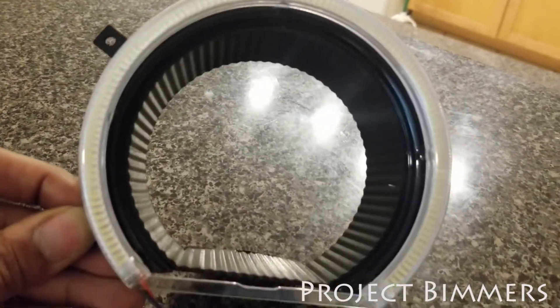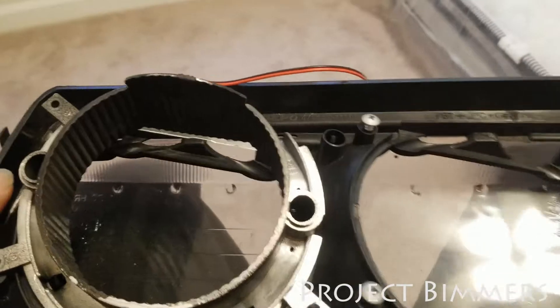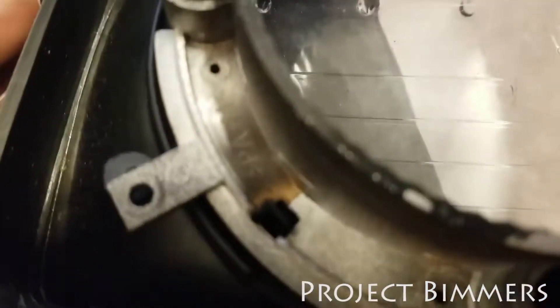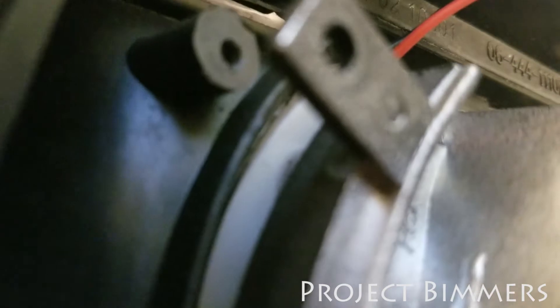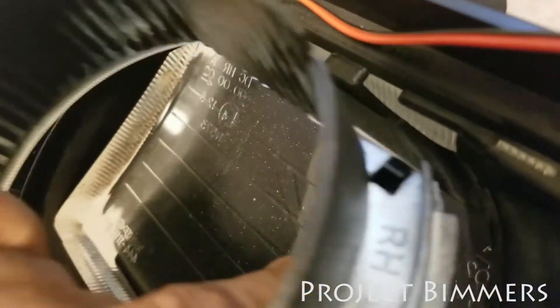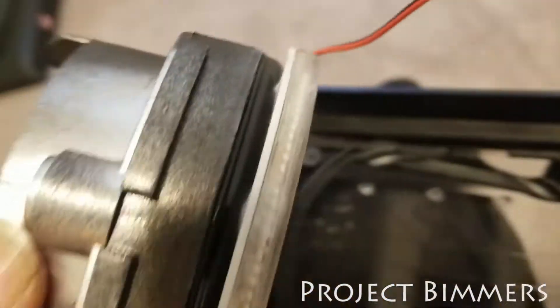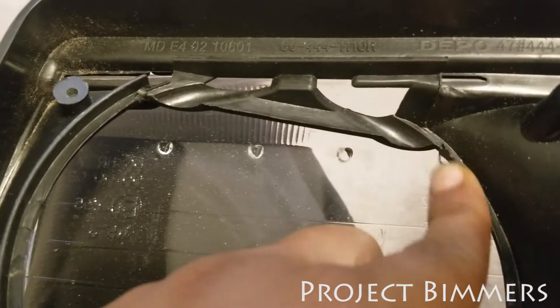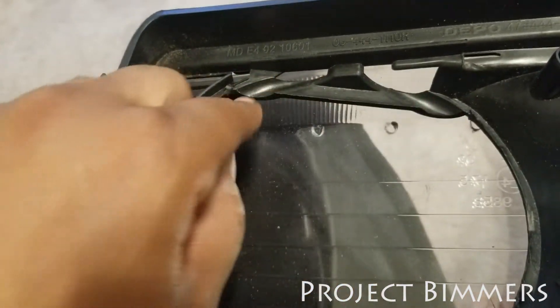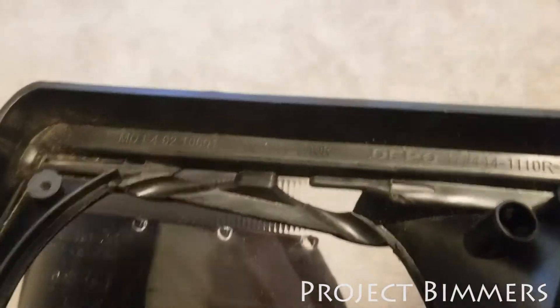They'll look just like this and ready to go in the car. The lights are already glued on — it's time to test fit them inside where they go. You see where those screw holes are — they're supposed to line up with these. The problem is that with the new halo ring on there, there are some edges where it hits and doesn't fit. You see there — it's hitting there, it's supposed to go under there but it can't. So I have to trim this area. I'm going to use my Dremel to do that.